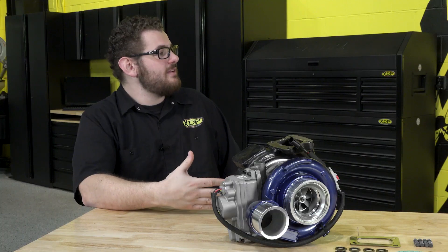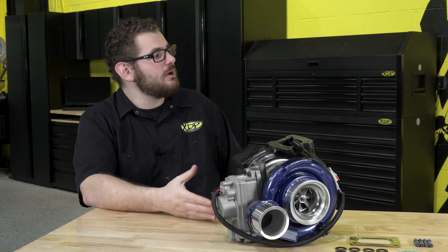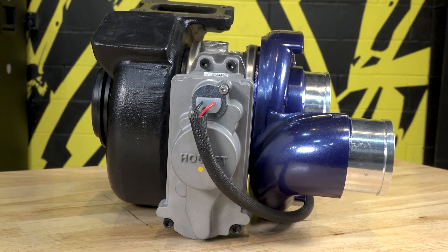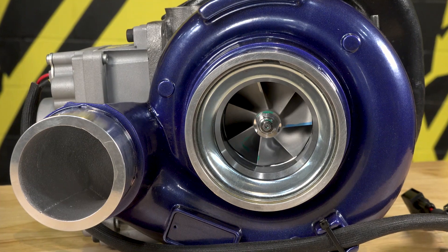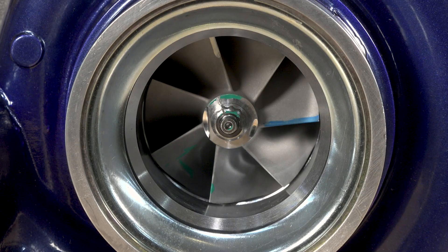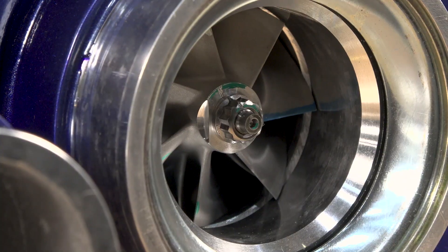So what kind of upgraded driving characteristics will someone experience after installing this turbo? One of the stigmas around a drop-in turbo is that they tend to be slow on the bottom end, and a lot of redesigned turbos clip the exhaust wheel. Since we cast our own housing, we can put whatever wheel we want in there. ATS Diesel is located in Denver, Colorado — it's a mile-high city, so we have less air — and we designed this turbo with similar spool-up characteristics as your factory turbo. But since we've put larger wheels in it and a better bearing section, we're going to have that higher mid-range power, upper end power, and we're also going to handle EGTs a lot better.